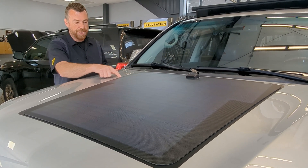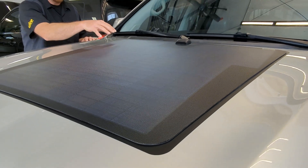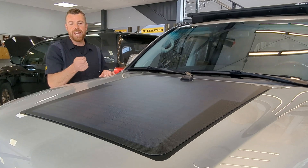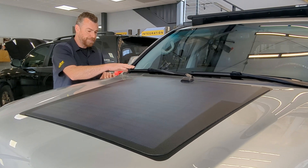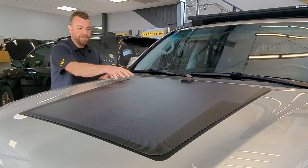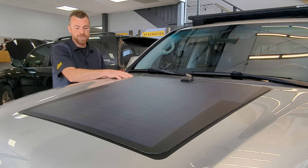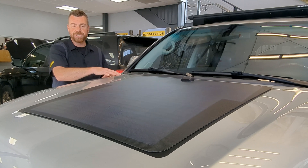What we see here is the vinyl panel that installs first. This vinyl panel is a 3M air-release panel, so it goes down very easily. That is to protect the paint on the vehicle. The separate solar panel comes with just a smooth backing on it. You're going to use a 3M VHB double-sided tape that the installer will provide to attach the solar panel to the vinyl pad. If you have a vehicle that's a little bit older and maybe the paint is damaged, you may choose to forego the vinyl and attach the solar panel right to your paint. It's not 100% required, but in most cases we're going to use these two items together, so that if you unfortunately have a solar panel failure or want to remove it at some point, you're going to protect the original surface of the paint.